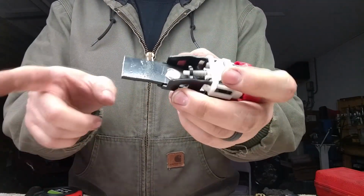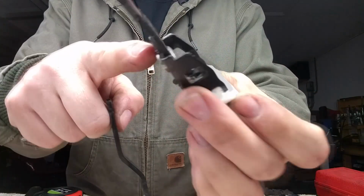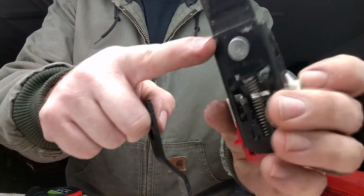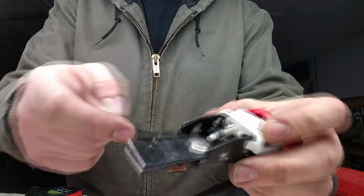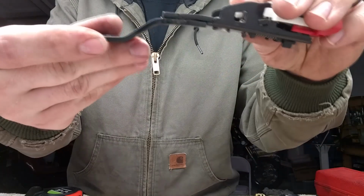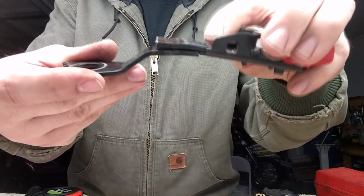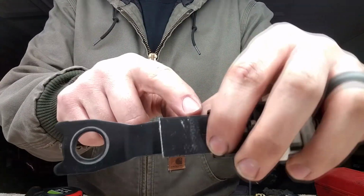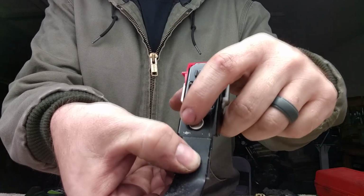Like I said, it was like 3 inches up from the tail end. This is the Mitsubishi one, and like I said, there's a little lip where the brackets are welded together in here, or riveted together. After I cut it, I got this. Kind of gonna butt together like that. That'll allow me to weld both sides down this lip and across here.